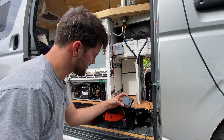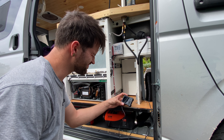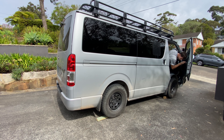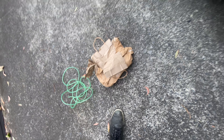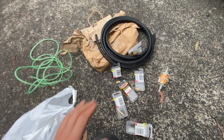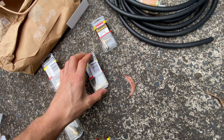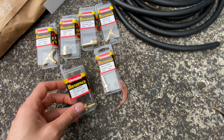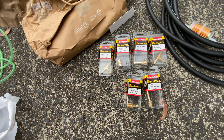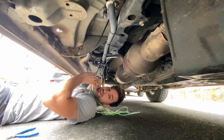It seems like it's all doing what it should be. Now let's get onto the diesel side of things, which is what I was a little bit daunted by. This is my bag of bits I've got left over for the rest of this heater install. To hook into the fuel tank I've got some fuel hose, a filter — because I don't want any crap going into the diesel heater — and then I went and bought just about every conceivable fitting I thought I might need. I'm going to use the supplied hose to get it to the back, where the fuel return line is, which is what I'm intending to hook into.